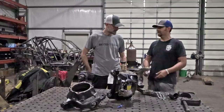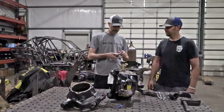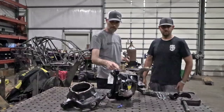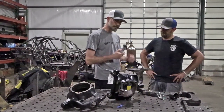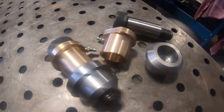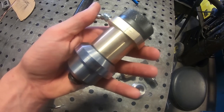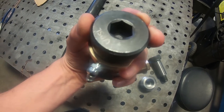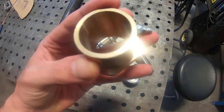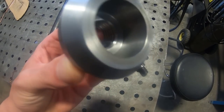What do you get in the ball joint eliminator kit? You get a pair of eliminators, the threaded bung that you install into the upper ear of the knuckle, your brass insert, and then the giant shoulder bolt that does really all the magic. They're sold with and without lower ball joints, so you'll see both listings on the website. We sell a high-quality Moog lower ball joint with these just to make it easy and get everything in one box.